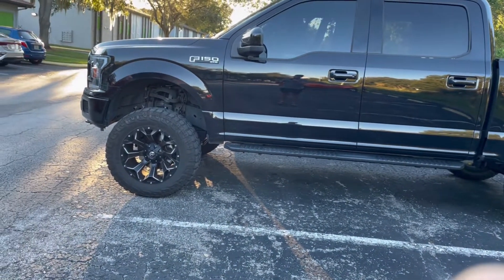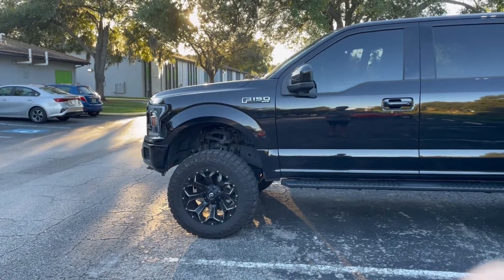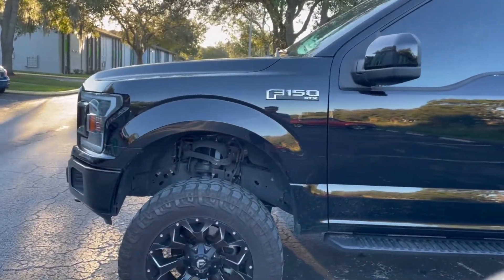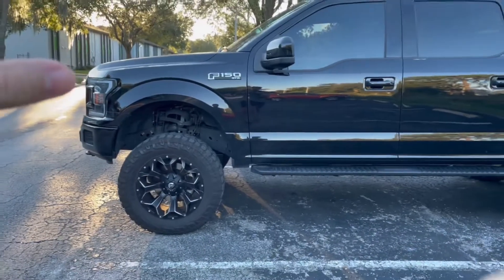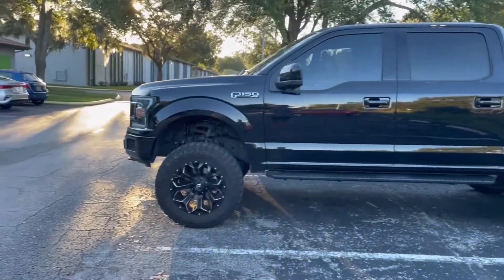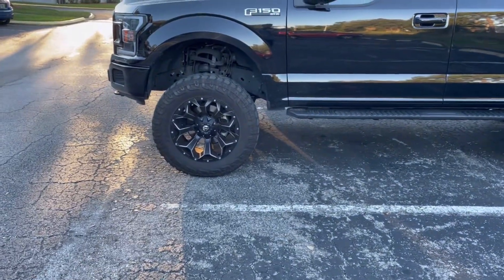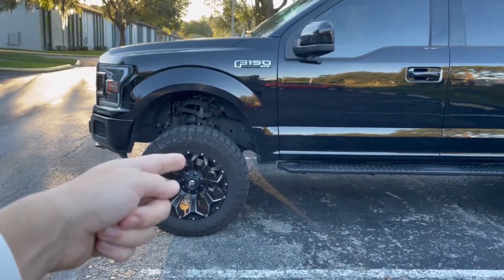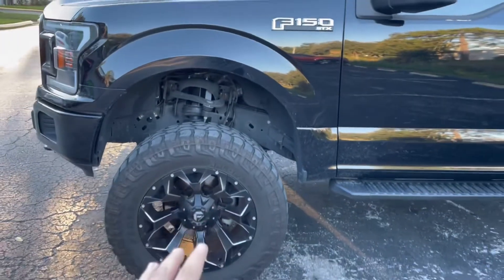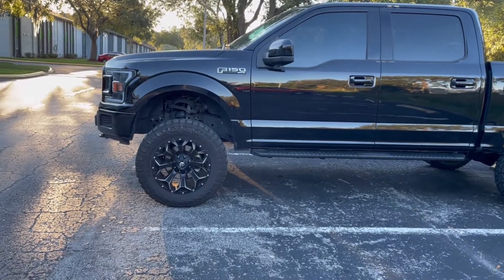The previous was 37 inches or three foot one, and now it is 44 to 45 inches. You may do the quick math and ask how that's possible — if you raised it six inches from 31 to 37, that would be 37 inches, right? That's just the lift kit. You have to include the tires because they're bigger as well. The tires went from a 32 to a 35, which is a three-inch difference. But you're not going to add the full three inches on top of your six-inch lift, because only the bottom of the tire is on the floor, the rest is in the air. So you take half of the diameter, which is one and a half inches. That means you really get 7.5 inches of total lift between the lift kit and the tires.